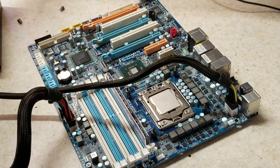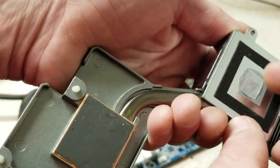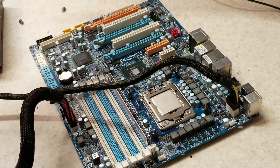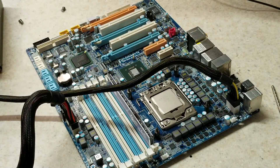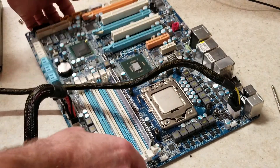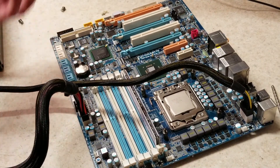1333 MHz RAM — not the fastest but still pretty decent. I took off all the heat sinks; you can see the paste on there is really hard and crunchy — that's going to have to be replaced. The thermal pads themselves still feel nice and soft. I went through and popped the CMOS battery out and held in the CMOS clear button. I don't think this is going to make much difference but we're going to find out.